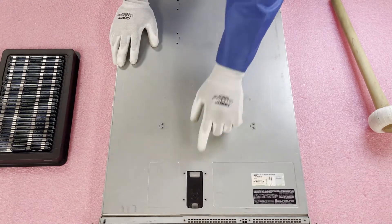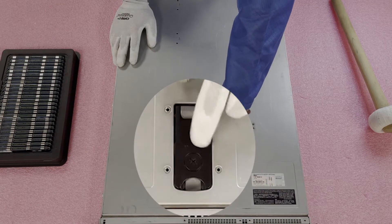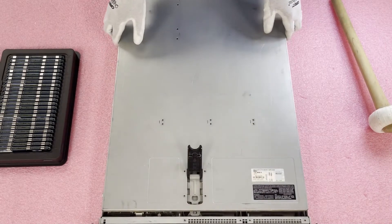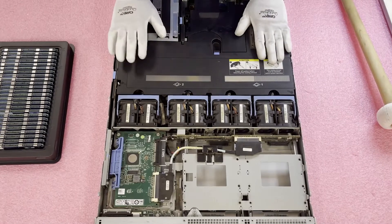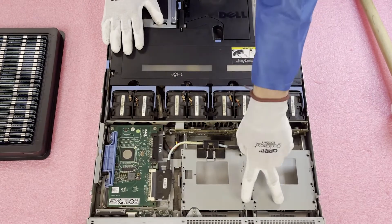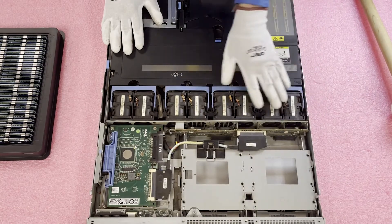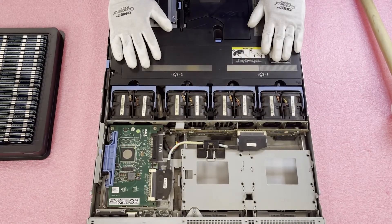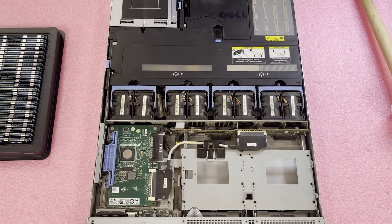Let's go ahead and show you how to open it up. There's a latch right here — you just need to make sure it's set to unlock. If it is locked, just grab a Phillips head. It's very simple: pop the latch up, lift open the top, pretty much just like any server you've ever been inside. You'll notice this specific machine is the large form factor chassis with two large form factor drive bays, all the fan modules, the air baffle to regulate airflow for the CPUs and memory modules, and two hot swap power supplies and a RAID controller in the back.